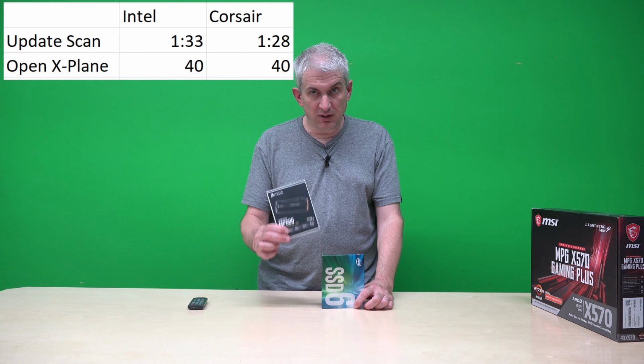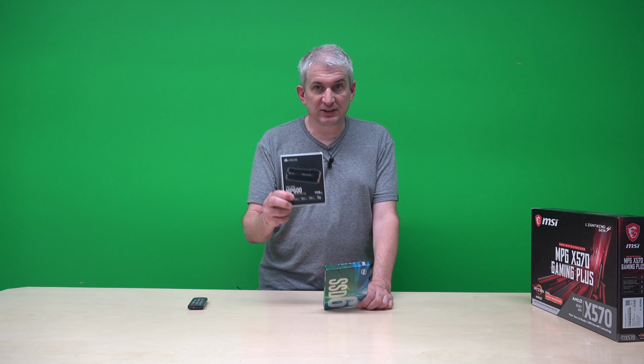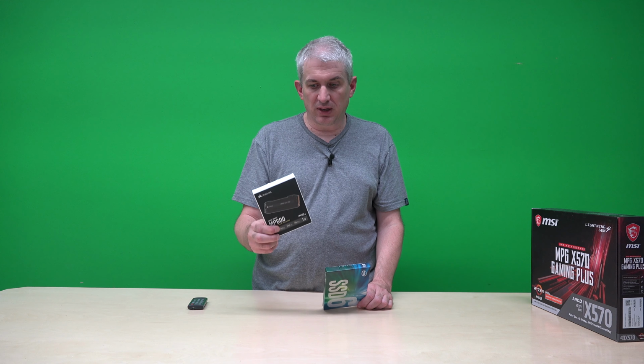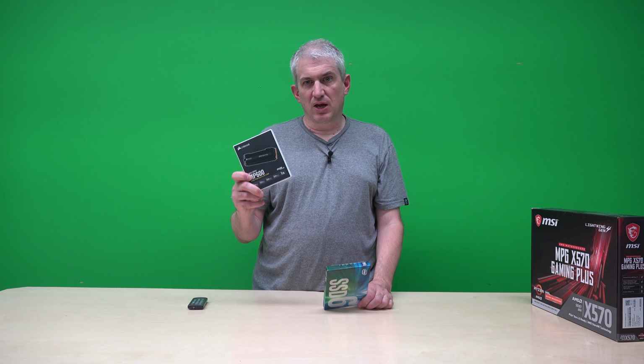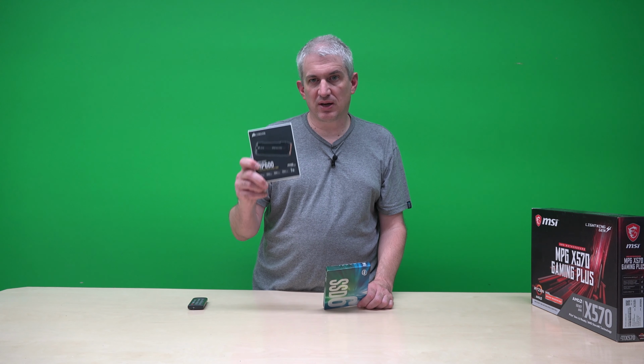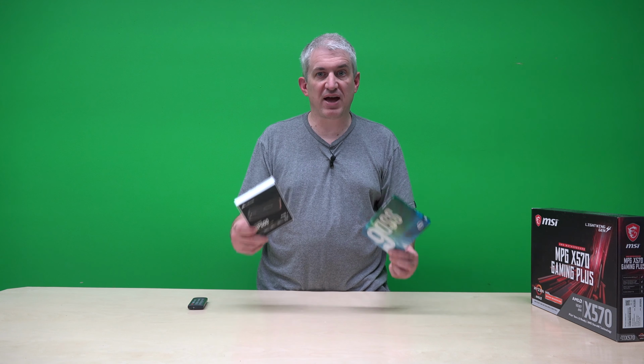So really, what's the point of this video? The point of this video is you probably don't need this. You probably don't need to spend double the money to get something that's PCI Express Gen 4, 5,000 megabytes per second, because just because this is 2.5 times faster than this, it doesn't mean your whole system is going to be 2.5 times faster. It doesn't mean that something disk intensive is going to run in 2.5 times faster time, because there's so many other factors involved.